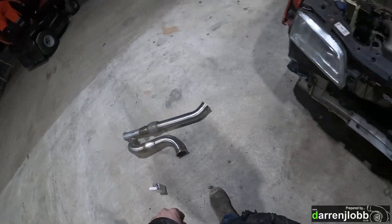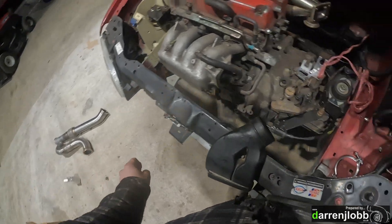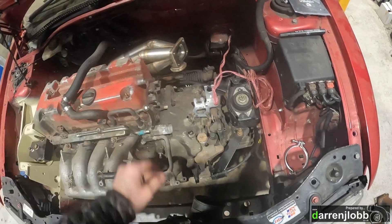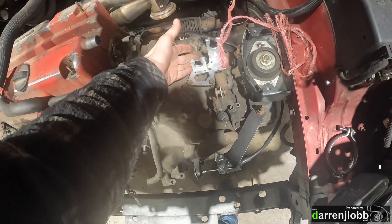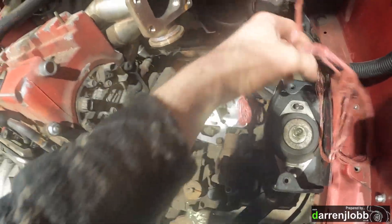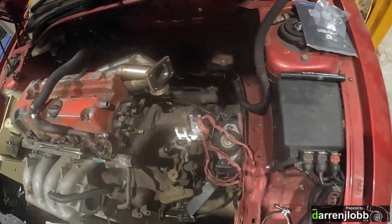I've just finished welding that downpipe now. I've got the turbo out and before I fit that again I want to get the gear linkage cables in, because you get a lot better access with the turbo out and obviously the downpipe out. So I've just been doing some measuring. We've got an aftermarket shifter that Sam's got, which came with a bracket for the cables and new cables. I've got a piece of string set to the length of the cables because I'm trying to find a place to go through the bulkhead.